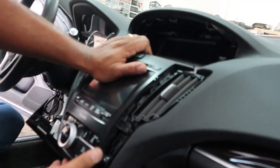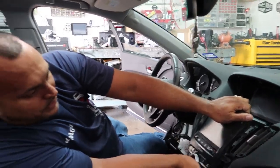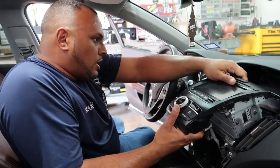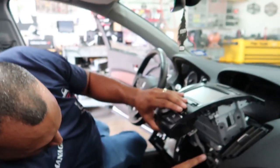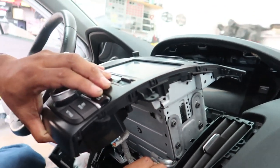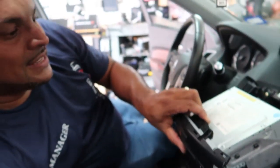Now that we have the bolts off on the bottom and everything is released on the side, you're gonna grab this head unit and start pulling on it. It is a screen — it's not a kit — you gotta pull it lightly, loosening it little by little. Look at the 8-millimeter bolts down here — I just loosened them, I did not take them out. They actually grab two hooks here, one from each side. So now I got the radio out.